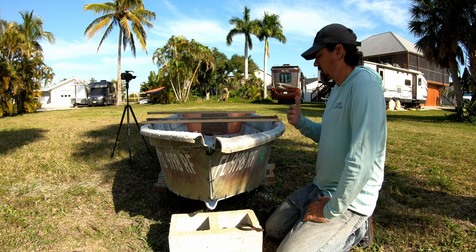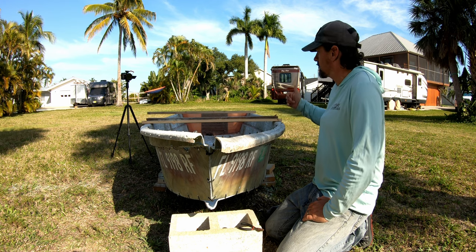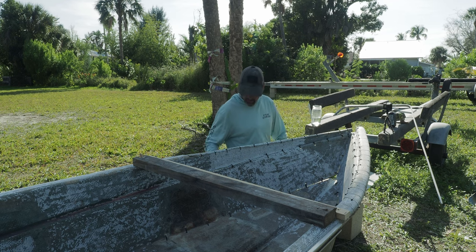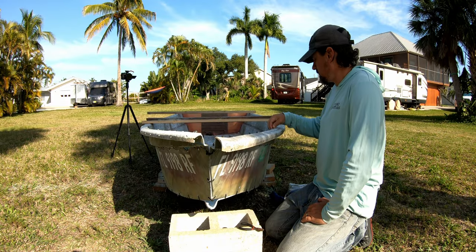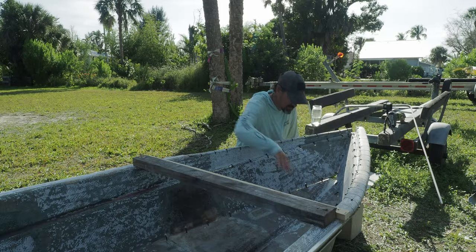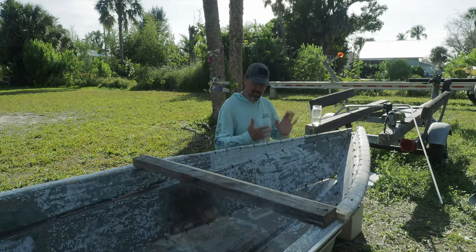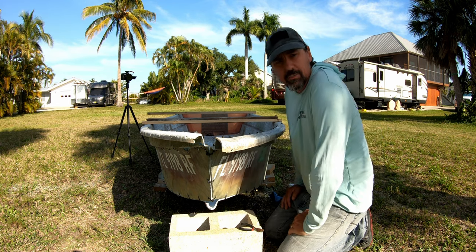What I've got to do now is take a section apart, clean it up with the grinder to get it ready to take some glue and glass, and then put it back together with new zip ties. I was waiting on a big bag of zip ties and those finally showed up. I'm going to start cutting out the old zip ties — these were lightweight garbage ones anyway and weren't really holding very well. I'm going to clean up every one of the seams really good so they'll hold glass no problem, make sure it's shaping properly, then zip tie it back together and mix up some glue.